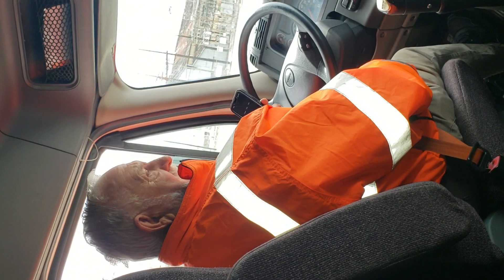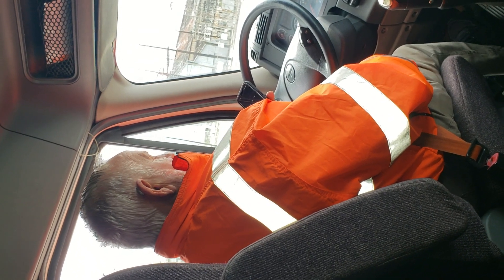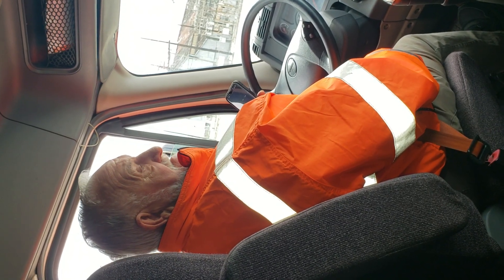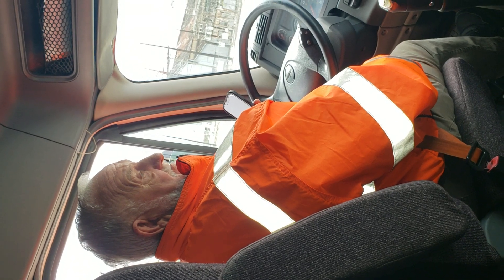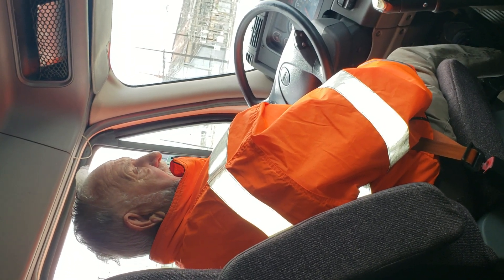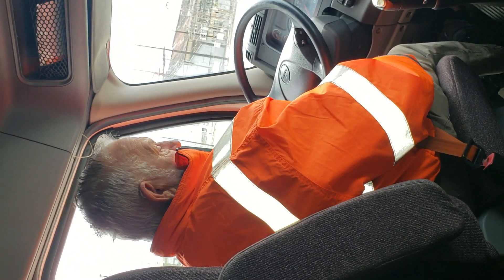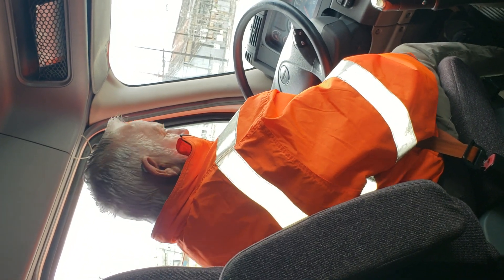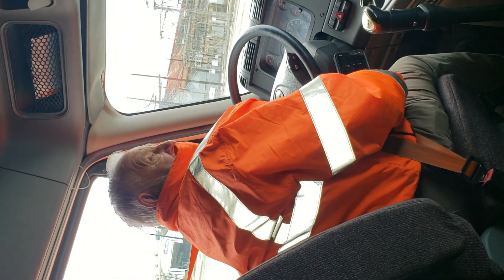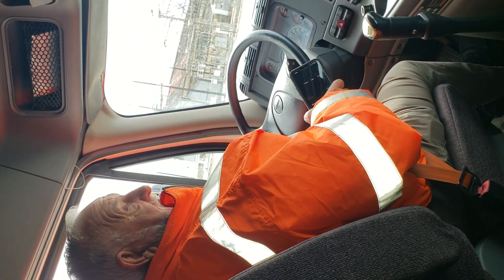It's been a minute. It did not lose more than 4 PSI. I'm going to fan the brakes, and at 60 pounds of air pressure the buzzer and light will come on, telling me it's a warning that I have an air leakage problem. I'm going to continue fanning the brakes, and between 20 and 45 pounds of air pressure both brake knobs will pop out — and they both popped out. Now, you turn the key off and tell the inspector that you have completed your in-cab inspection.